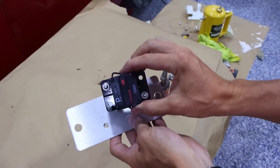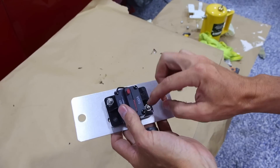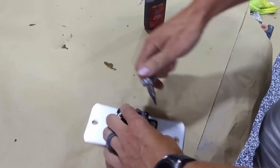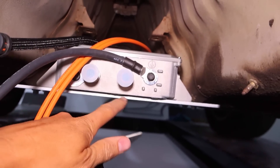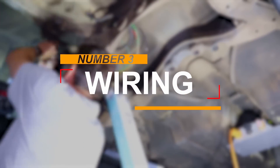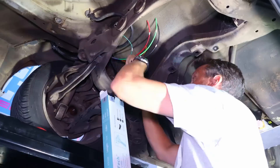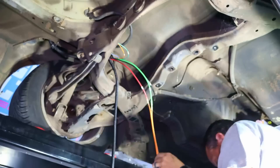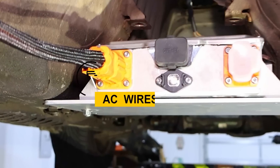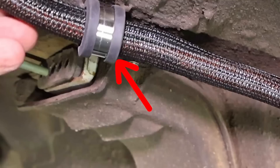Another bracket we've got is for the circuit breaker, so we're going to go ahead and bolt that on and get the wires wired up. This bracket is actually going to go above the CCU right there. Interestingly enough, it's probably one of the strongest mounts in the whole car — it held up the drive shaft, and now it's holding up one of the smallest things we've got. We've got the AC wires coming from the charge port into the combined charging unit, and I've got some cable clamps so things are nice and tidy, routed up over the subframe.